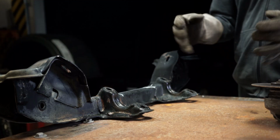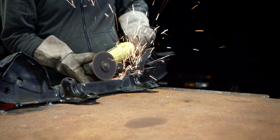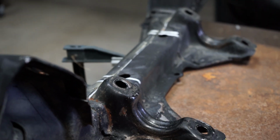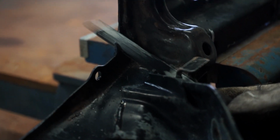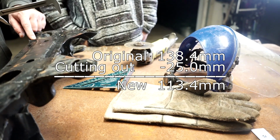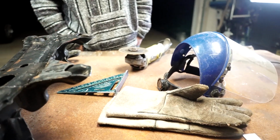I need a bandsaw on a table so I can walk up and just chomp and make that cut. It's just, these lines just need to meet up when I get done. This is going to force me to center of those holes because that's the narrowest point. I got you. See what I'm saying? This piece is still going to be existent, and this piece is still going to be existent. So we subtract 25 millimeters. It doesn't matter what the rest of it looks like. It can all be off as long as I use these two, which are dead on, and just cut 25 millimeters off of that. All the rest is wrong. The cuts just need to be in a place where the puzzle fits back together.